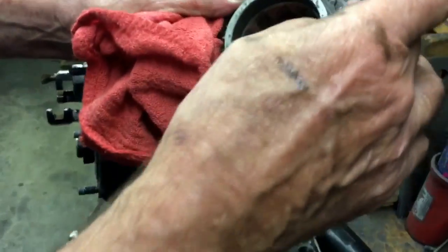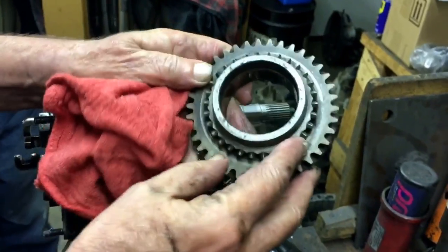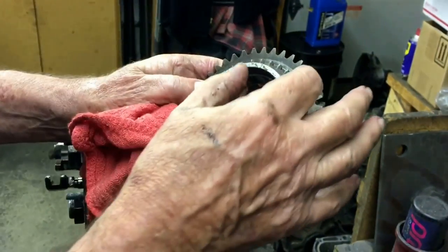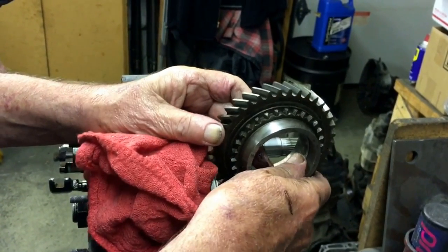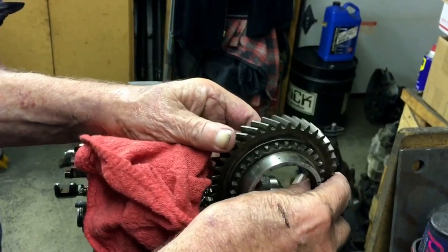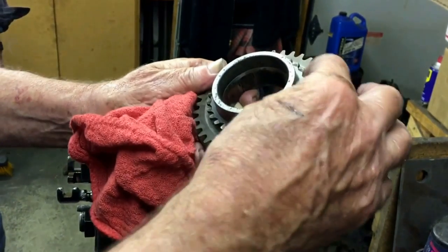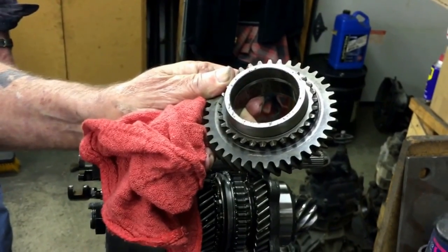So for example, these steel synchro teeth here, from the day the Volkswagen comes out of the factory to the day it hits the junkyard, it only wears 9 steel teeth. The way you can pick them out is you put it on the side here and pick out the shiny ones, and if you knock out those in threes, you see 1, 2, 3. If you knock them off, the transmission will pick up the remaining, which are brand new and never been touched. So that's a rebuilder's trick, and that can be done in all 4 gears.